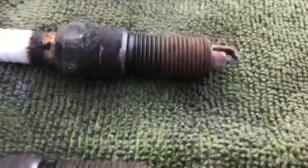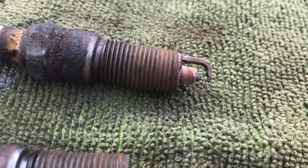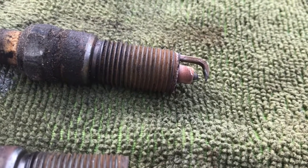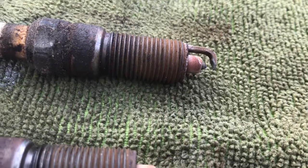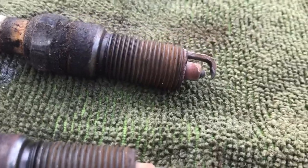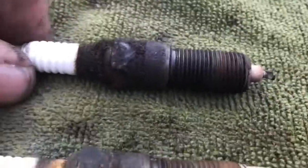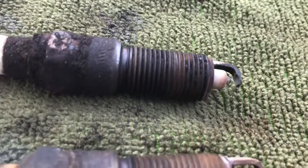It started misfiring pretty bad. I put a coil on it, and it ran good for about 2 days, and it started misfiring bad again. And I thought, man, is that coil defective? I bought it off RockAuto, but it'd take an act of Congress to get them to warranty it. So I decided to put plugs and wires on it. Had never had any put on it, and that's a good thing I did.